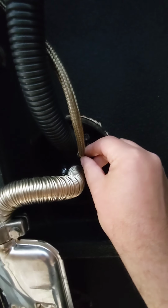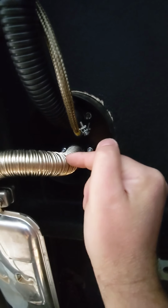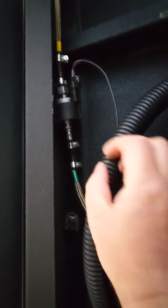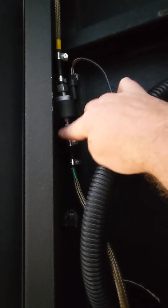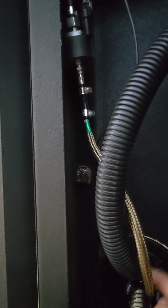This is the fuel line. So as you can see, I've got that fiber around it, so that I've come down and I've tried to take it away from the muffler as quick as I could. So that's why it's going over the top of this air intake hose. This is the pump. So it's placed at a slight angle going up towards the heater.